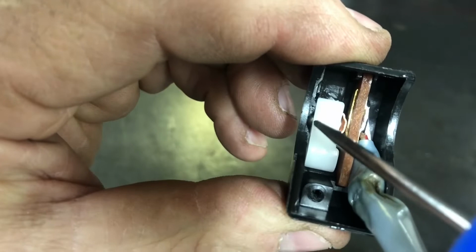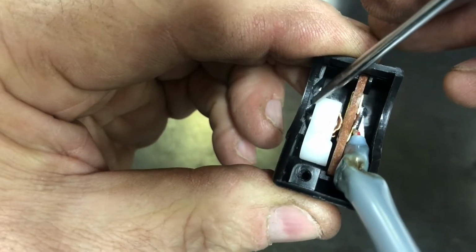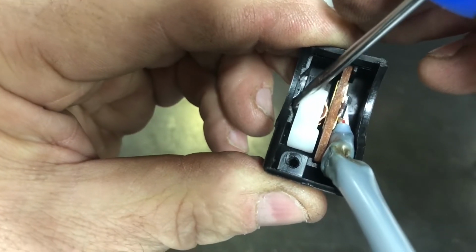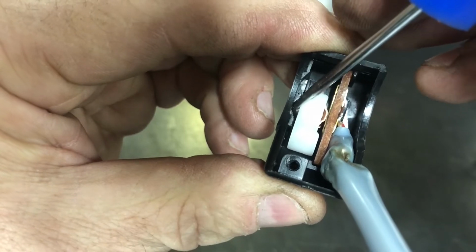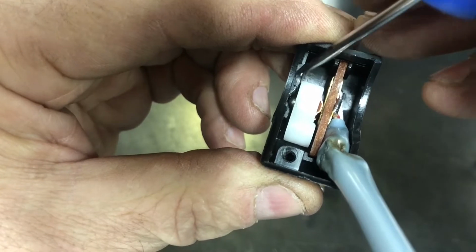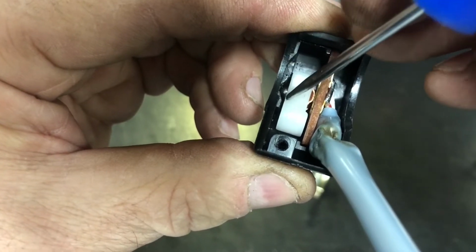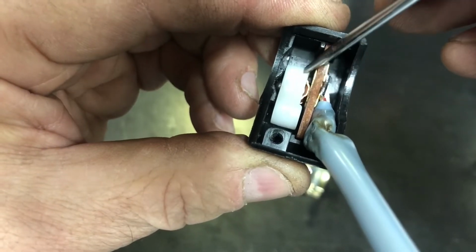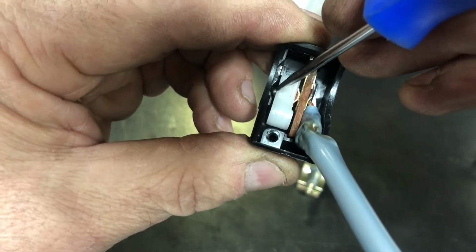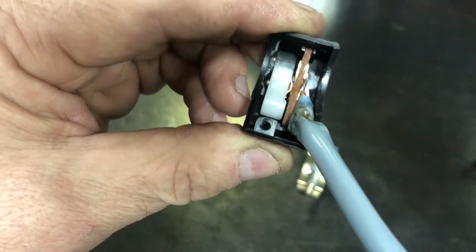The ball bearing is right in here. And the black plastic piece has a spot, a divot right there for the ball bearing to go in. Then it pushes it in. There's a high spot there and then another low spot there. And that's the indents for the high and low switch. As you move this white piece from high to low, it moves forward and the ball bearing gets pushed in and then pops back out to hold it in place right here for the other one.